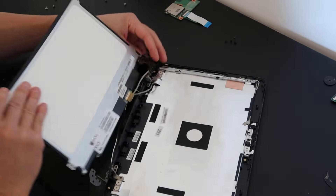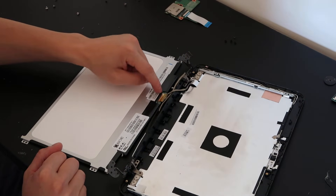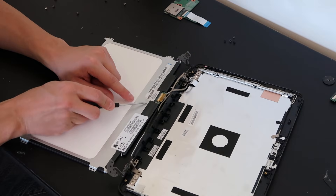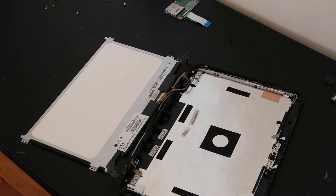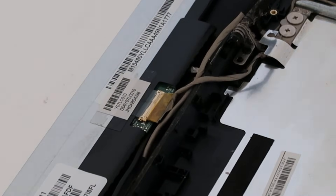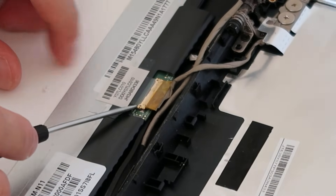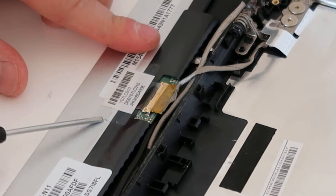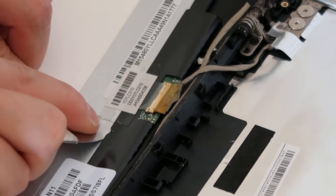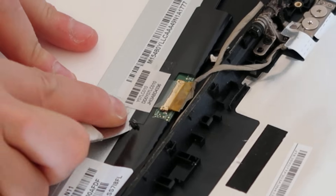The last thing to do to unplug your LCD is a bit tricky — it's held in by tape first, so slowly and gently take this tape up. The connection is very easy to break; this wire is very flimsy where it attaches to the port. Zoom in because this is a tricky part. Get the sticker started nice and easy, peeling it up toward the connector.